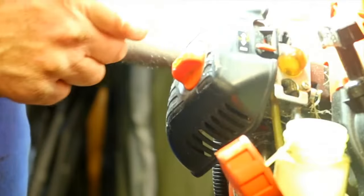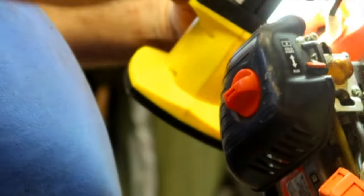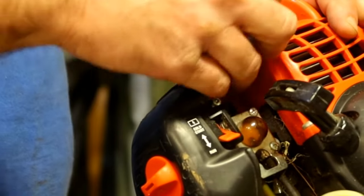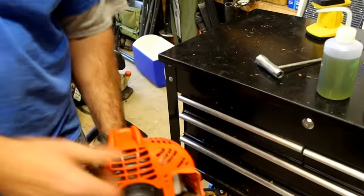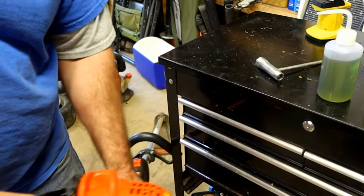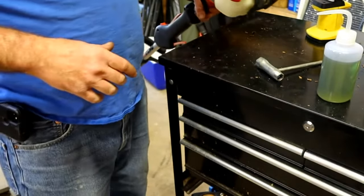I was noticing some lines on the cylinder wall, but it didn't look terrible, like it was something catastrophic. So I think we're actually just looking at normal wear and tear. Adding two-stroke to it, that test is going to check spark, compression, timing, a whole lot of stuff, right? It takes the carburetor out of the mix. So we know the motor runs.